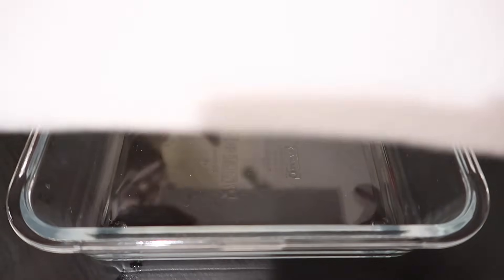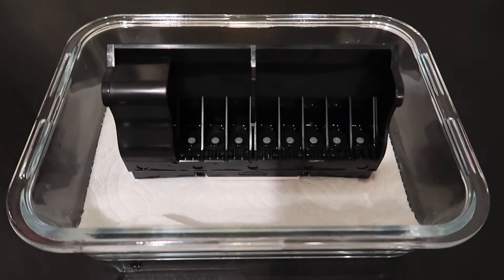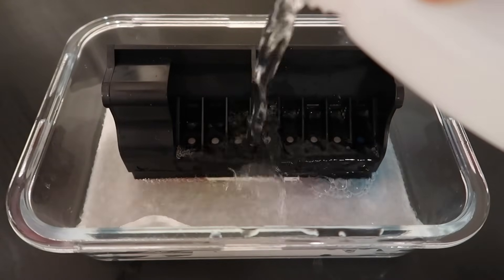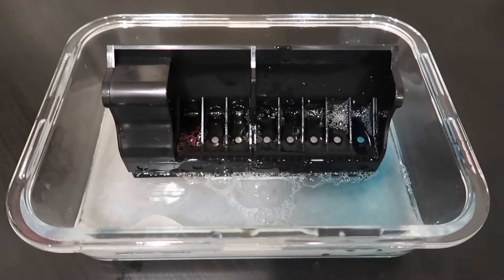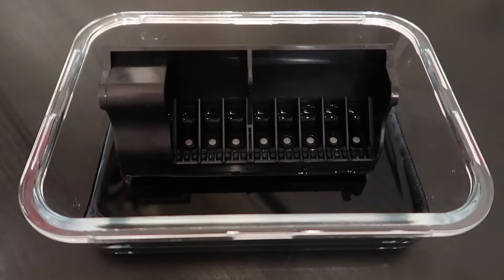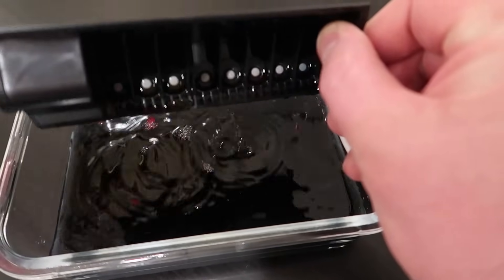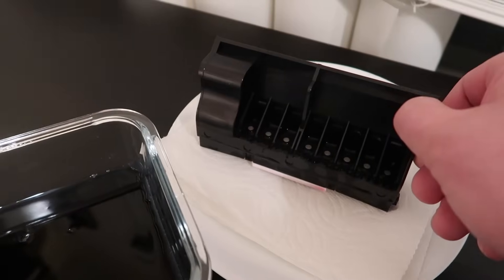It's very easy to make yourself: 10 parts distilled water, 2 parts isopropyl alcohol, and 1 part ammonia. I place the printhead down on a paper towel, pour in about a quarter of an inch of solution, and make sure I also get the cleaning solution onto these little mesh screens where the ink travels through the printhead. This one was sitting for quite a while, but really 24 to 48 hours max is what you should do. As it dried or seeped down, I would pour more solution into the top just to make sure those screens had enough solution to work their way through.